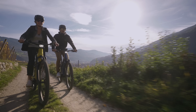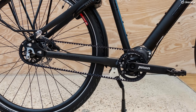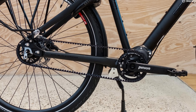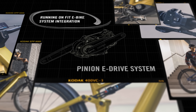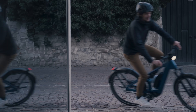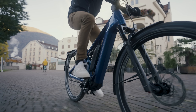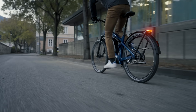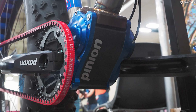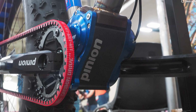Is this the future of electric bike technology and will it finally be able to convince more people to ditch their coveted derailleurs? Pinion has been making its bicycle gearboxes for more than a decade. While they are popular with riders who want a reliable, basically maintenance-free drivetrain, they haven't really managed to crack the mainstream, where derailleurs still rule the roost. Increased drag is the primary problem with gearboxes for bikes. Back in their Porsche days, the engineers at Pinion had powerful engines to overcome the drag in their car's gearboxes. That drag is more of a problem on a bicycle, where the power of a rider is obviously a lot less, and the difference between a gearbox and a derailleur drivetrain can really be felt through the pedals.